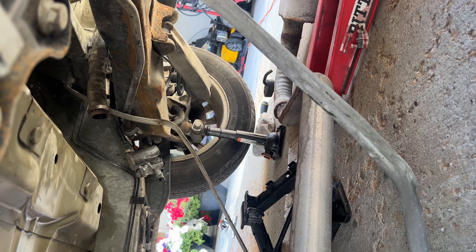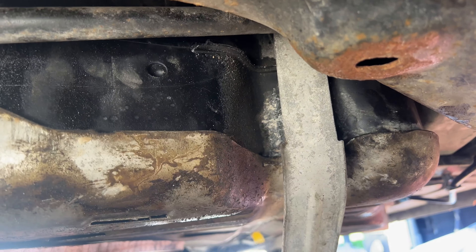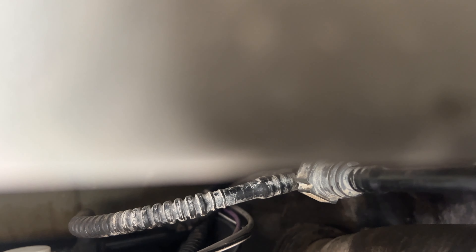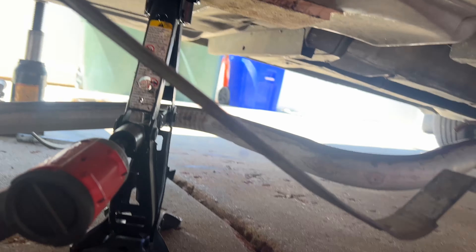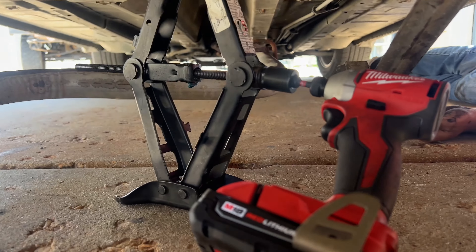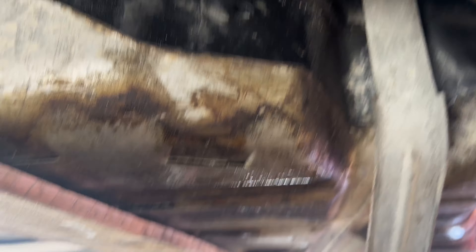That one's your fuel neck and right there is for the vent. We're gonna get this placed underneath and start hooking it back up. The fuel tank is up underneath now — the breather line is hooked up, the filler neck is on, that vent line is hooked up, and there are two fuel lines up front and the wire connector is hooked up. We've got our nifty little fuel tank holder with the board.